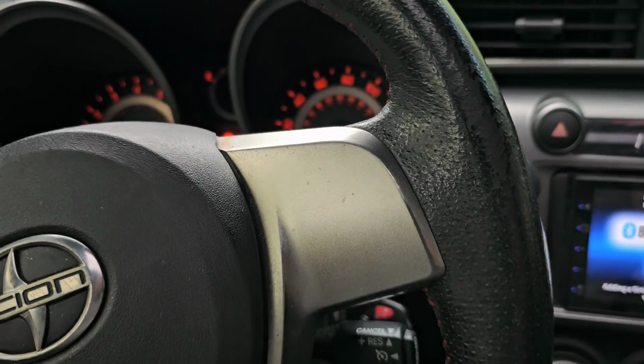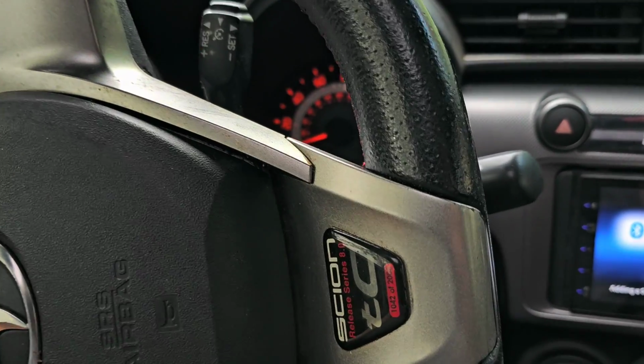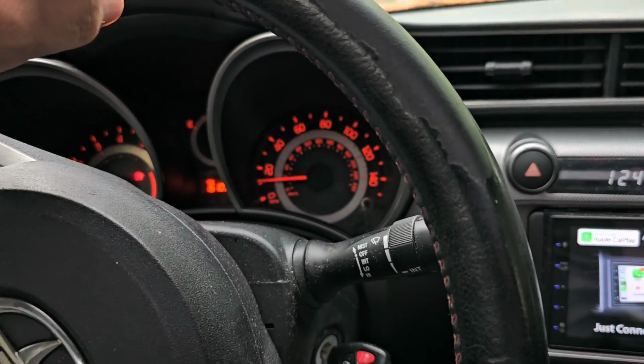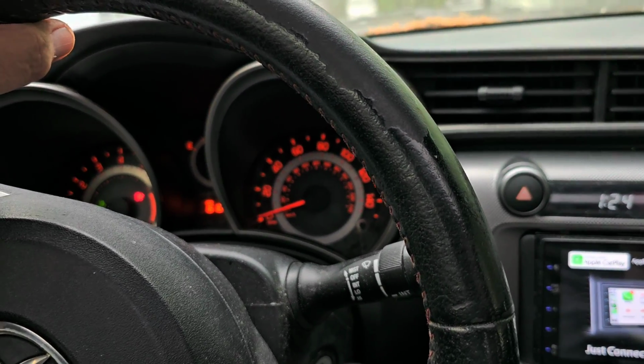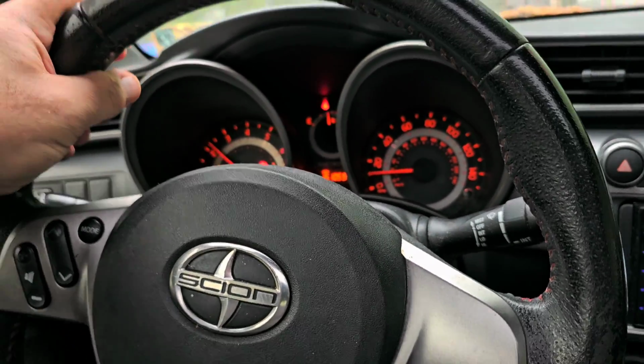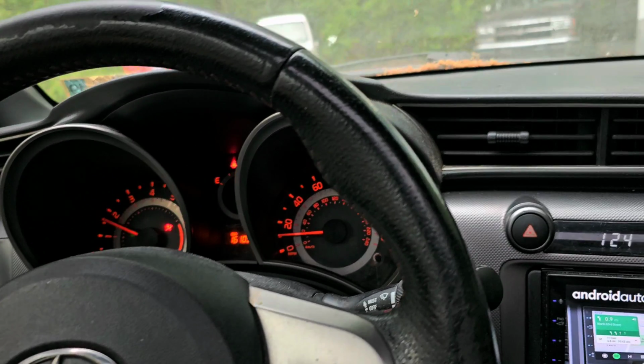Well, guess what? Something's wrong with the tranny. Let me see if you can hear this. So we're going to start accelerating. You hear that? Roar, roar, roar. Okay, that's the input bearing. Input bearing is shot, or something along those lines. I got a beeping chime here for a seatbelt. I'm not going to put that on. Let me get this in the shop.